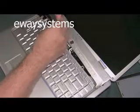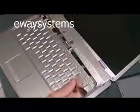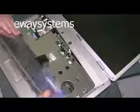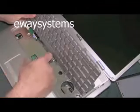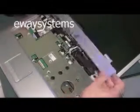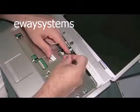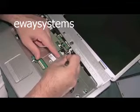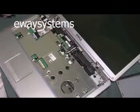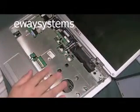Let's get onto the keyboard and see if we can get that ribbon cable off. There's two screws holding the keyboard on. Now you have access to the keyboard — on a Dell, you just pop that up and it comes right out. It's much easier to get this one out than the other one; the other one was kind of glued in there with some tape. So let's just push each side of that connector up and pull that ribbon cable out. Now we can get this guy out of the way. Let's take a look at what we got here and see if we see any major damage — I don't see anything yet.